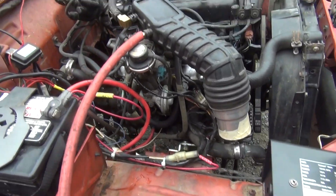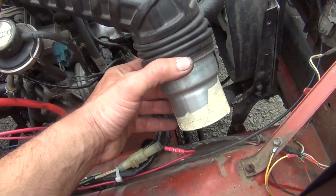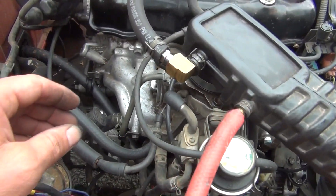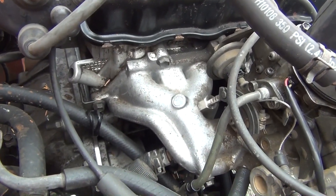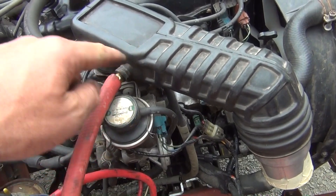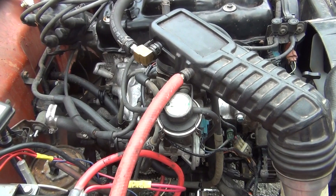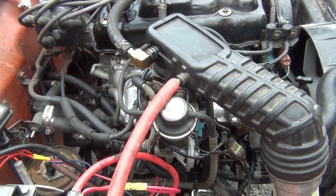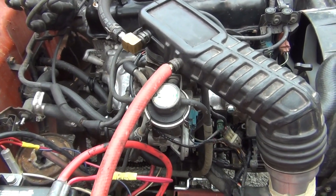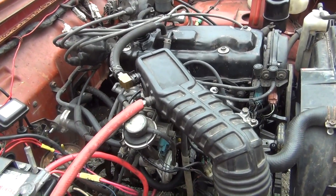What I've done here is taped up the air intake — I got a little exhaust adapter and put masking tape over it. Then I blocked the throttle open. You can see that little fitting I've got propping the throttle open. This allows the smoke in right here, down through the throttle body and into the engine. It will actually fill up the whole intake manifold with smoke, and anywhere there's a leak, we'll see the smoke show up. We shouldn't see any smoke as long as the intake system and all the vacuum lines are tight.